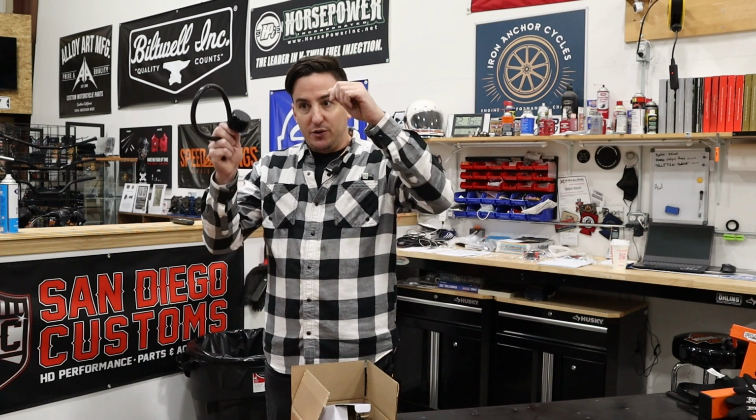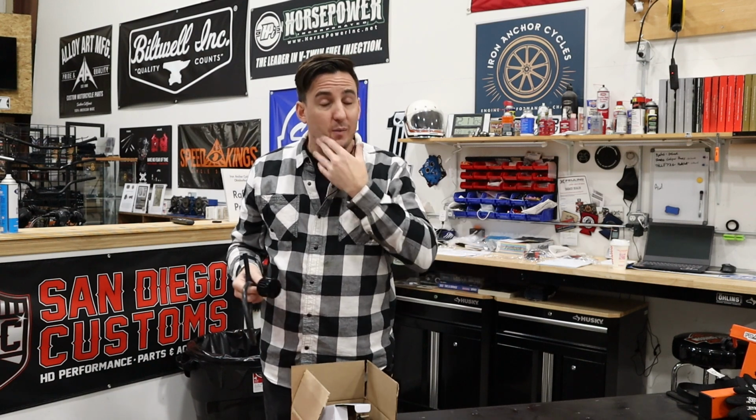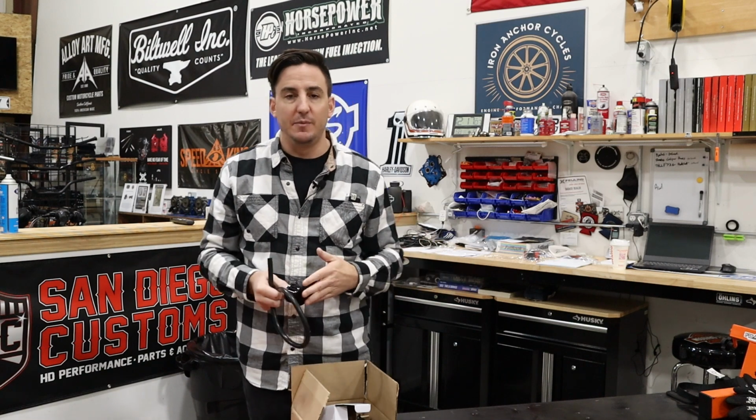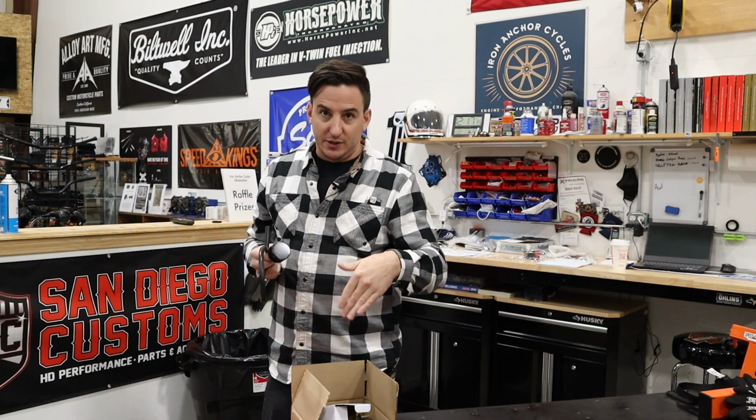So you'll take those external breathers, and usually we just run them down. You could put a catch can or something like that. You usually just run them down to the ground, and if a couple little drops of oil come out of there, they just go to the ground and it's not a big deal. But it's not solving the problem. It's just moving the oil from going into your air cleaner down to the ground. So obviously that does solve your symptom problems.